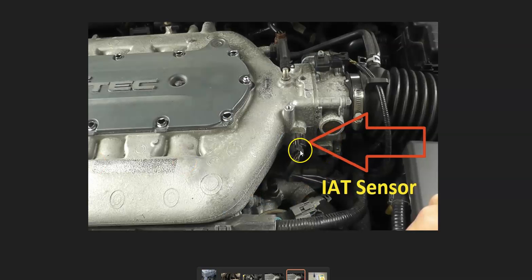Once you find the intake air temperature sensor, the first thing to do — especially with this code — is to check out the wiring and harness. Make sure it's plugged in all the way, check all the pins to be sure they look good, and inspect the wiring going into the sensor. This code is pointing to a wiring problem, and bad wiring can have the same symptoms as a bad sensor. You'll need the schematics for your particular year and Honda engine to know exactly what's going on.